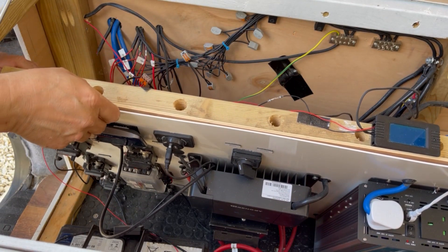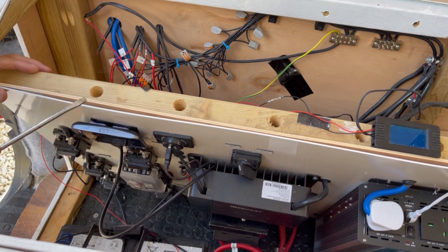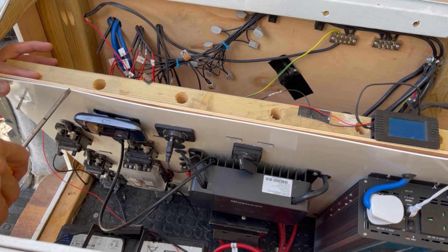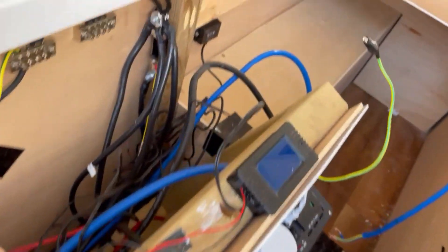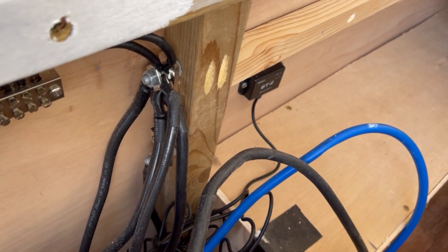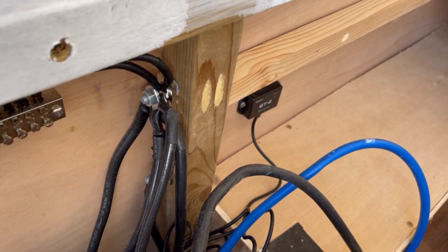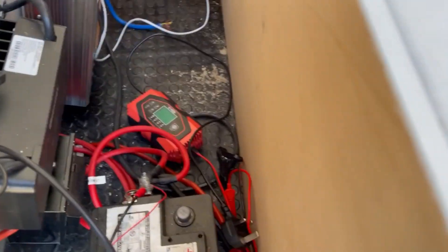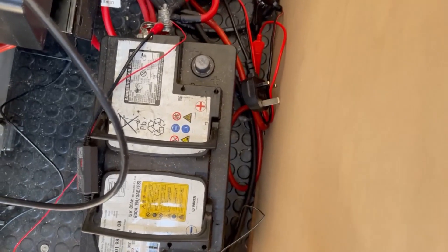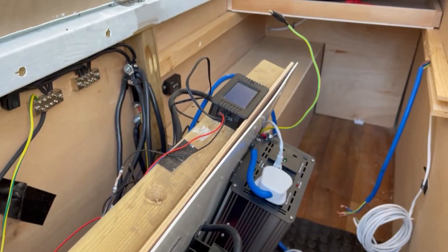You won't like what you see behind, but there you go. Let's stop this from falling completely. Okay, so that's the thing I've got to change, which is fairly simple because you've just got to undo it all and replace it with the new shunt - it shouldn't be that difficult. But while I'm here I think I'll do some tidying up, maybe paint the wood. I've got a new 200 amp hour lithium battery coming, so I may as well tidy all this up before it arrives. Let's get this shunt in and see how I get on.